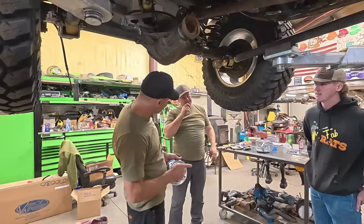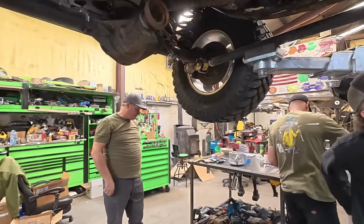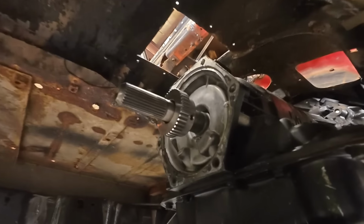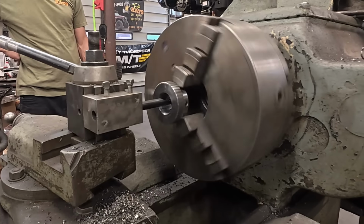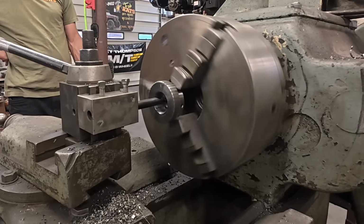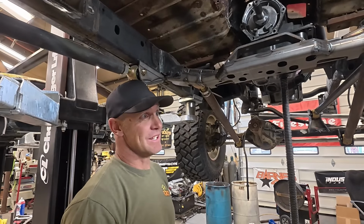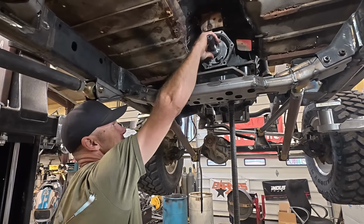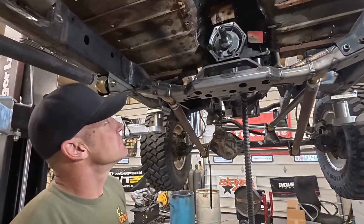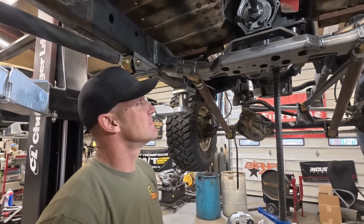No, that ain't moving. Chuck it up in the lathe and skim a little out of it. Yeah, it's got locks on it. We'll make it fit. We'll skim it and then it'll go right in. Yeah, that's a lot better. That's plenty tight for what that needs to be. It's got set screws on it. It doesn't wobble, but it didn't need a press fit. We'll put Loctite on those and set them once we get the depth set, and it's there.